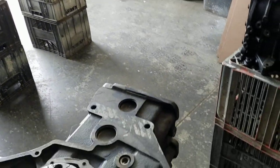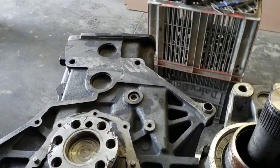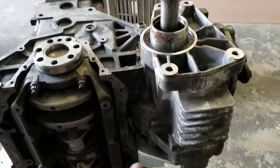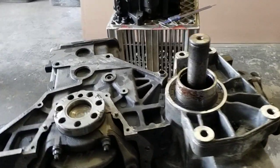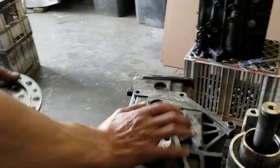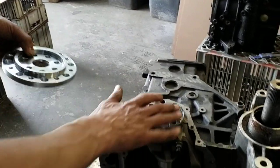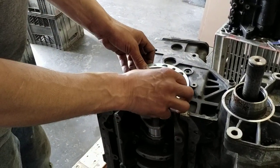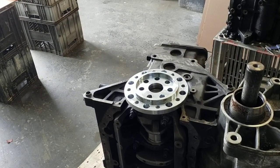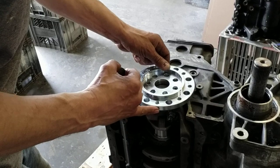We'll get to this when we've got the gearbox on. Once you're confident there's enough clearance behind — at least two or three millimeters — get a piece of plastic or cardboard and stick it behind there to make sure nothing is touching. Then make sure your crank is nice and clean. Your factory crank bolts will fit, and even ARPs will clear — there's enough clearance for the ARPs as well.